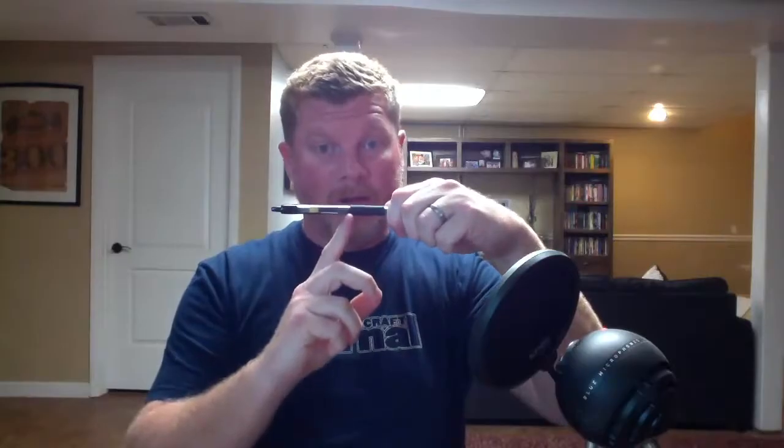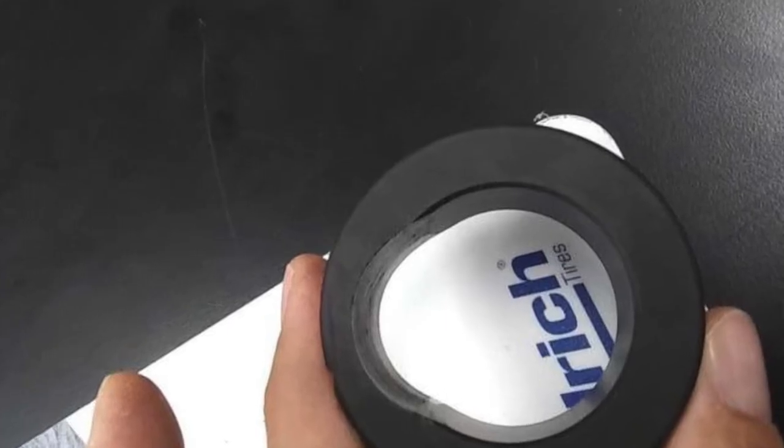What that means is the shaft itself is loose and the prop is oscillating. Think of it this way: here's the engine, here's the prop — if the prop has a big range of motion at the tail end, your carbon seal is further up the shaft. It might not look as drastic at the seal, but it's enough that it's eating away at your carbon seal. So pay attention to your wear rings — they're a telltale item.